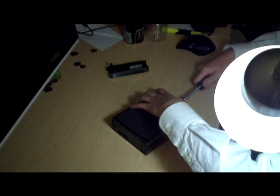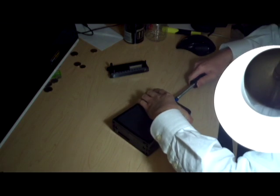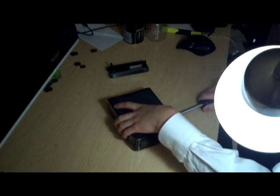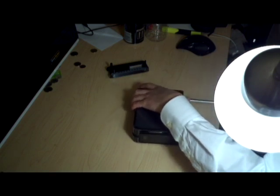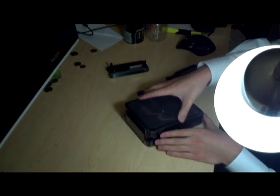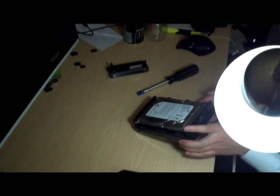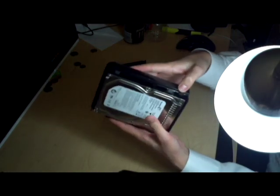Just keep going along the side of the case and crank it open — you'll feel the clips give. You'll hear it too. It's held in by clips on all four sides. The back is a little hard to get out, so once you get three sides off, you can just pry the last side off. Once it's out, you'll notice those clips actually turned out pretty well.